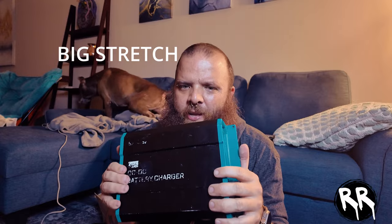This end connects to the circuit breaker and this end connects to the starter battery. From the other end of the circuit breaker, the wire runs through the firewall to the DC-to-DC charger. I'm thinking of mounting the charger underneath the passenger seat — I'm a little nervous about that, so we'll see how it goes during the install.